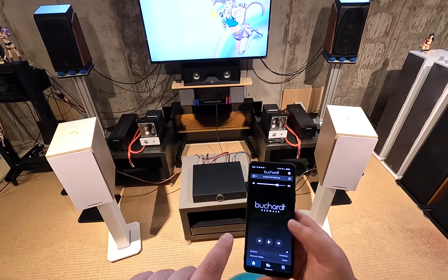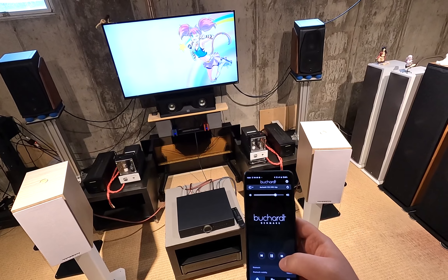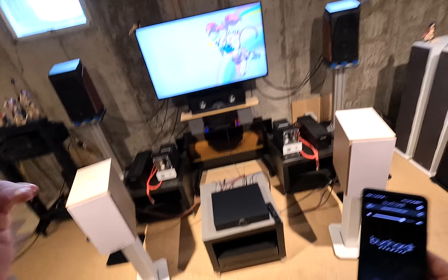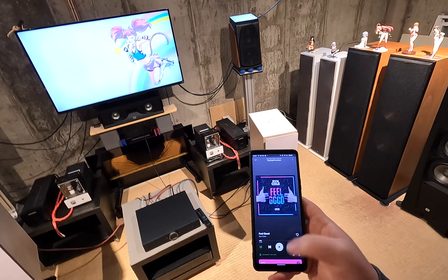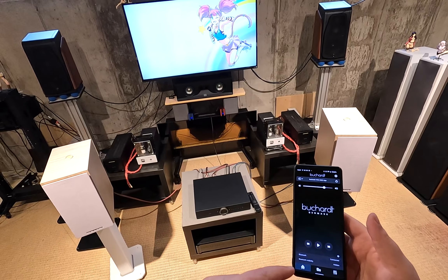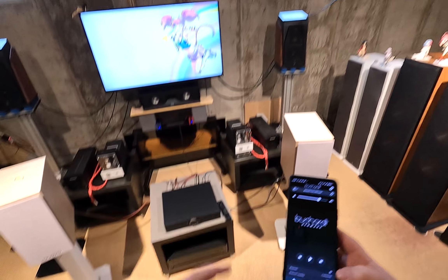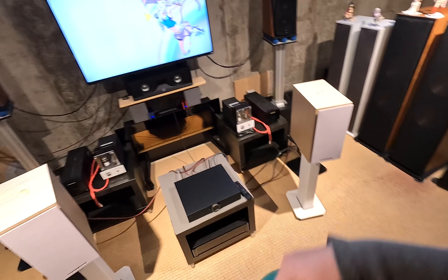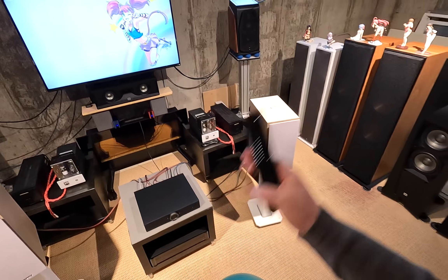Back on the main screen you've got play, pause, next track, last track — controls whatever is playing. There's a little lag on play/pause versus using the streaming app directly. Bluetooth visibility: when you set it to visible it puts the unit into pairing mode. One important tip: I spent 25 minutes figuring this out — to pair Bluetooth, put it into Bluetooth mode and then hold the next track button on the remote for five seconds.